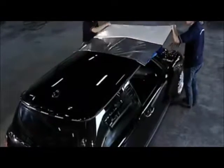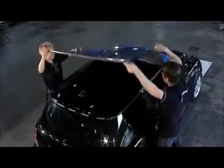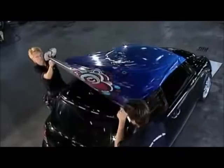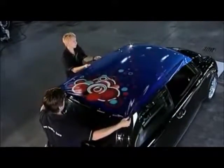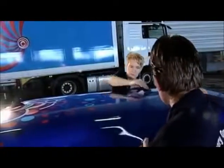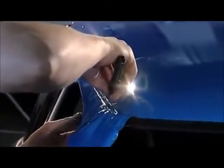Then attach the film that is not yet fastened to the applied film and remove the backing. Tautly relay the film and apply it firmly by using the squeegee from the middle of the film. The film is sufficiently flexible to fit snugly over the edges of the roof. All excess film over the edge is cut away.